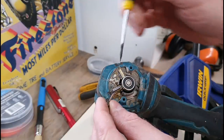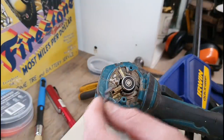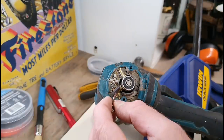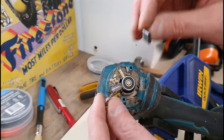These make the contact — they sit in these little holders and make the connection. They're spring-loaded, so they need to move up and down and slide as the drill moves. What happens is the spring keeps them permanently pushed down, but this one heated up, got wedged and jammed, and just hasn't been able to work as efficiently as it should be.